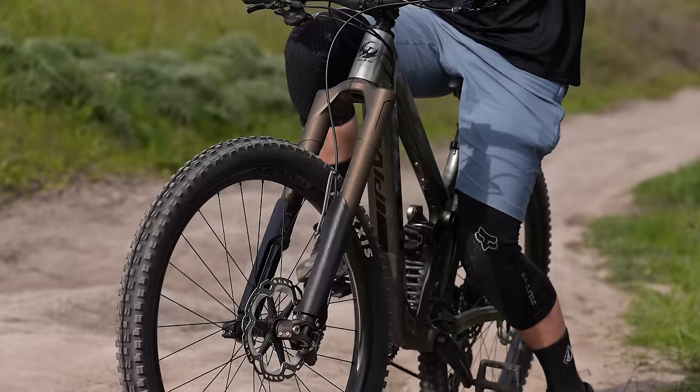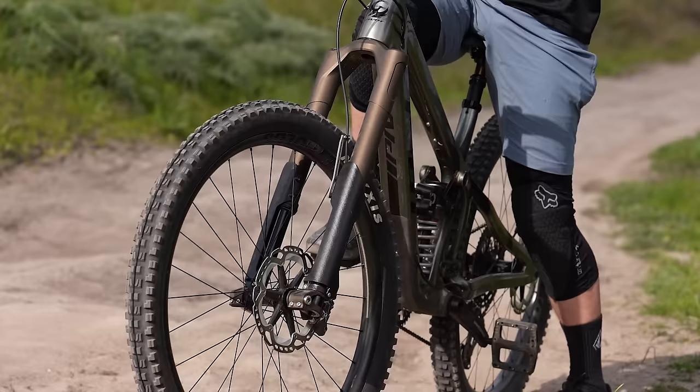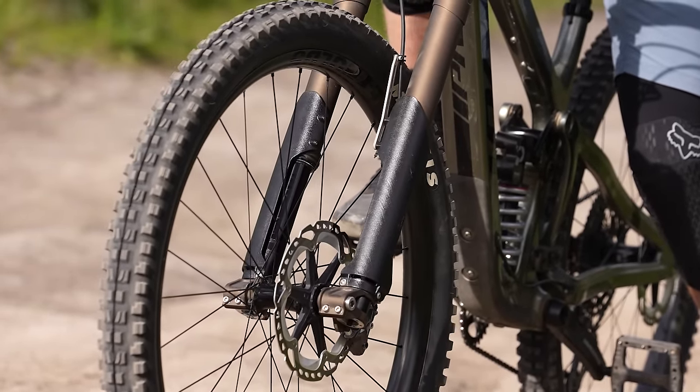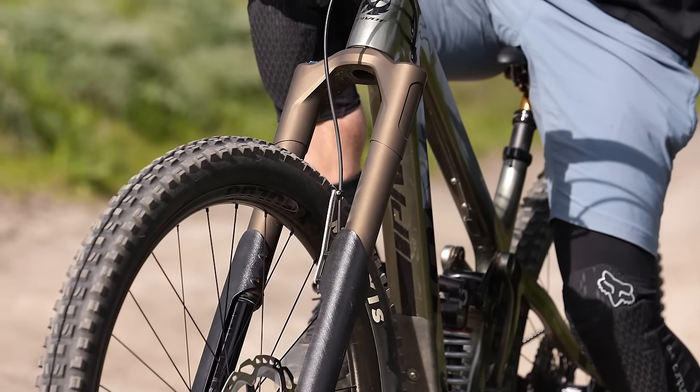You can certainly make torsional flex bad, but you have to learn how to make it work for you — where to tune it and where to tune in stiffness. That's what we've spent an exhaustive amount of time developing: building a chassis that works purposefully. That's why you see our dual single-crown design — the crown wraps down to add stiffness where needed. The fork doesn't actually twist; it does a fore-aft motion, so we're controlling that, not actual tube twisting. Ultimately, torsional flex in hard cornering actually provides beneficial mechanical grip.